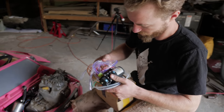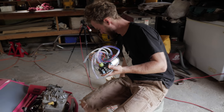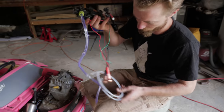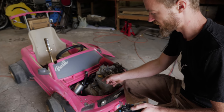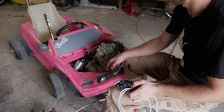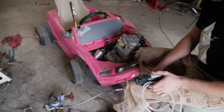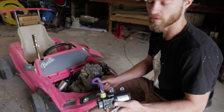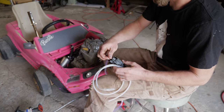This is actually a cheaper and potentially less quality pump, but it has a maximum pressure rating of 100 PSI. That one's designed to flow 3.7 gallons a minute, and I don't know what its maximum pressure rating is, but when trying to flow 3.7 gallons a minute through all these tiny passageways it can't handle it and shuts off. This is rated for 4 liters a minute, so a lot less. As long as it keeps flowing and doesn't shut off, it should be plenty of flow for the turbo.